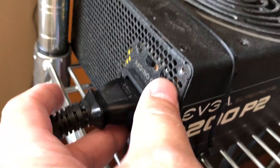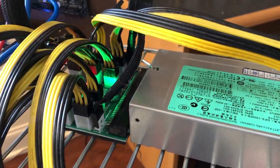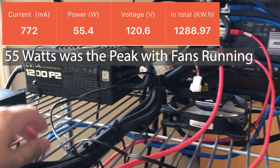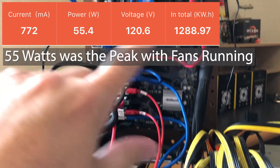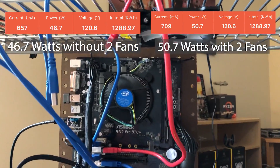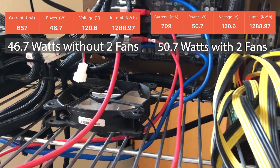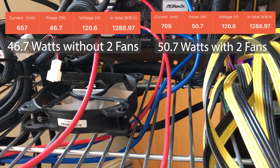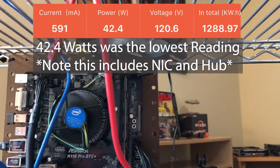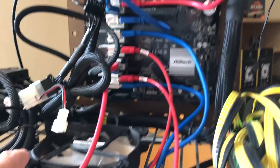Let's power on the board. Bingo! Server power supply is on — we got fans. So it looks like I'm running about 55 watts with network connectivity and both power supplies connected, no risers, no GPUs. I disconnected both fans just to confirm their draw — I knew it was about two to three watts, and sure enough the screenshots from the wattage app show we dropped about two and a half to three watts. So when you're budgeting: budget about three watts on the high side per fan.